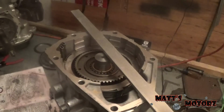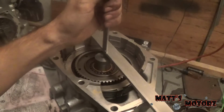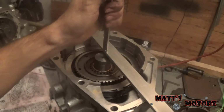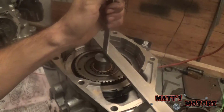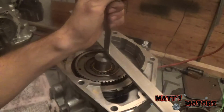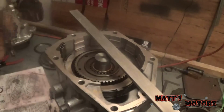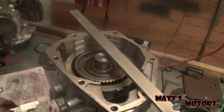So you put this over it, and you take your calipers and set them on the stock nice and flat. The special tool has a slot in it, so you could mill that if you have the capabilities. Then you just put it down until it touches, and take your reading like that. Again, I did that 3 or 4 times, took an average, and that gave me my final result.